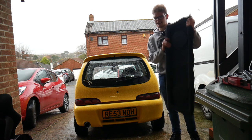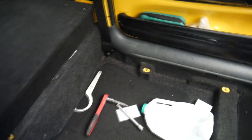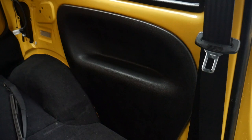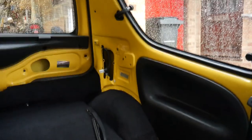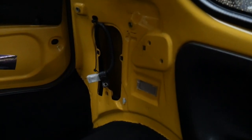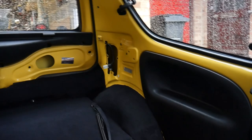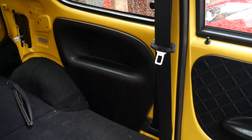So the plan for today is to take the speakers out of this parcel shelf and fit them into the back of the car. I've already removed the passenger seat — you can see a coilover spanner and some painkillers down there. The plan is to remove these standard rear door cards, make some new flat panels to go here and integrate those speakers. The wiring for the parcel shelf speakers still exists — I just cable tied it up — so I should only need to feed it back through the inner arch up to where the new speaker mount will be.